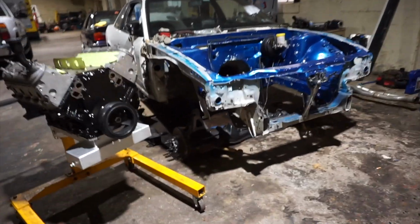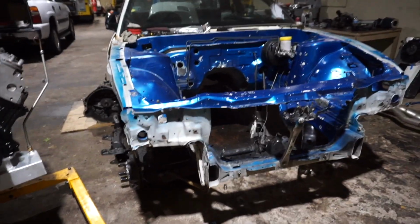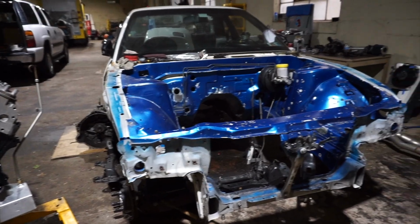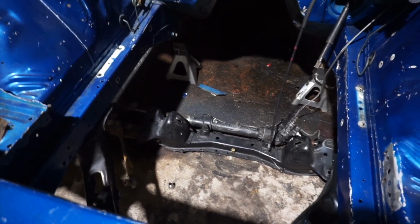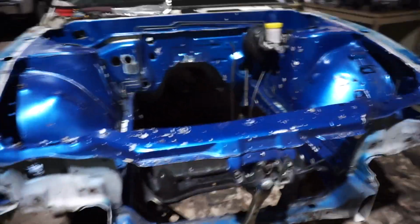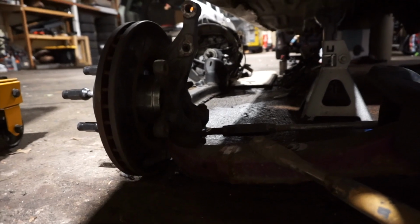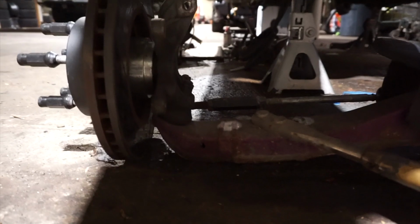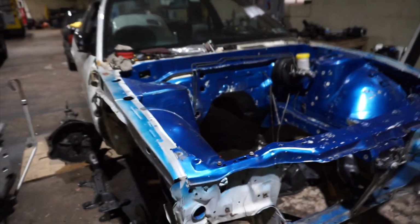So it's gonna be pretty simple, I guess, as far as a competitive drift car is considered. It's LS T56. We're gonna run some of the suspension, I believe, off of the gray KA car. I'm gonna take the front lower control arms and PBM knuckles off of that and run them on here. This, I was told, not that I honestly really trust it, is apparently a knuckle modded by Villains. Extended lower control arm, looks like maybe an inch, 25 mil. 5 lug front and rear, Z32 brakes, Z32 rear dual caliper setup.